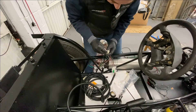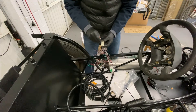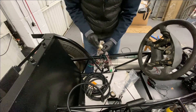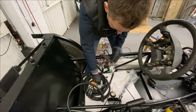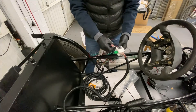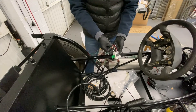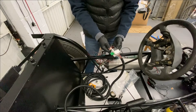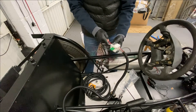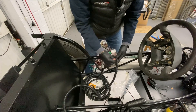So take this plug right out again. This one's slightly different — it's got a little lid on the top. You have to prise that lid up, and then you can get in and pluck the pins out like that. As I said, one of these is a loop out and in, which is the grey-red wire. The grey-red loops out and loops back on itself. And the other one, I think, is the reverse light feed. That way, we've done away with that additional plug — that was all I wanted to achieve here.